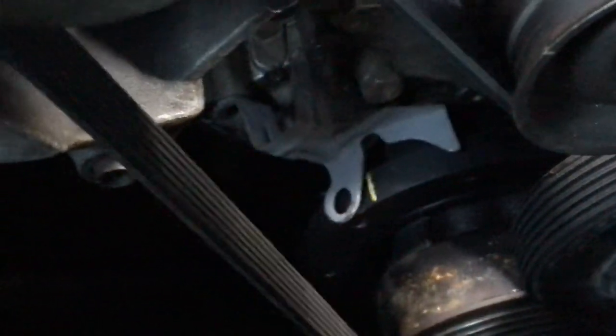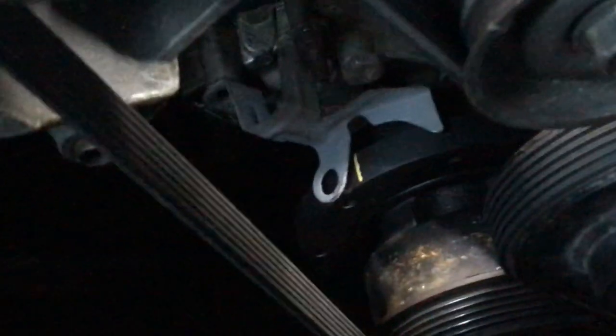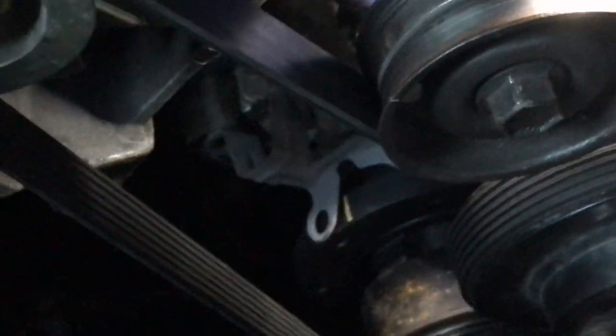Number one plug. You have your harmonic balancer marked with a paint marker, whatever you can come up with. Sharpies don't work too good. Go get you a permanent paint marker and mark it at 10 degrees. That's what you're going to want on these cars now, unless you've got it really hopped up. But okay, now that's about all I'm going to show you there.